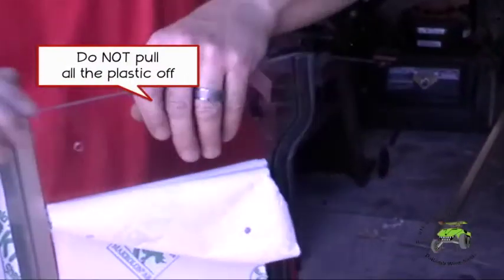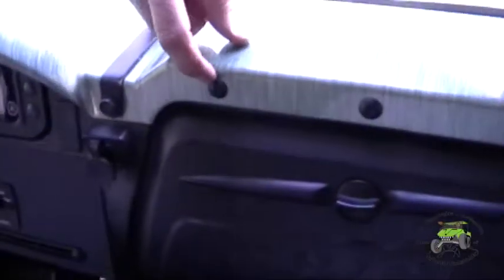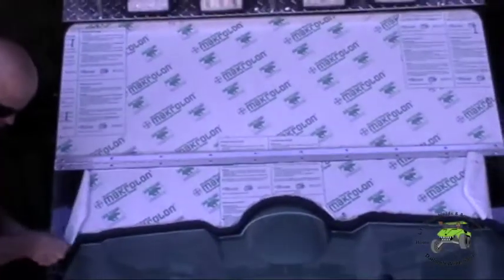To start with, I'm just peeling this plastic back just a little bit, just past those little holes where the screws go in. I've already installed these brackets right here. Move these little plastic things out — just unscrew with a Phillips head and it'll pop out. We supply you with the body bolt and bracket. You want to set it on here loose to begin with — just put that on loose. Once we get it set, then you'll cinch them down tight. That's almost step number one.